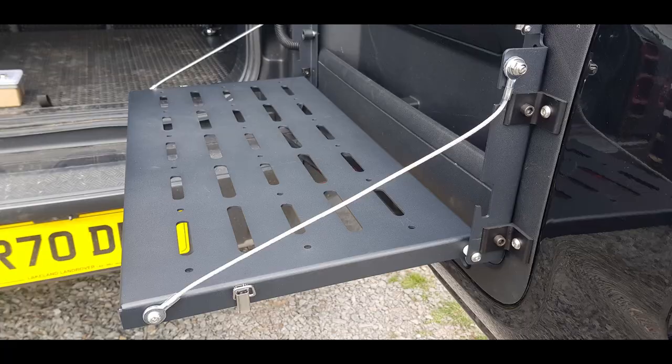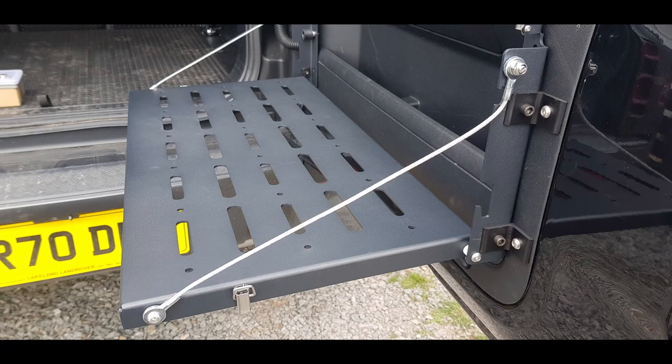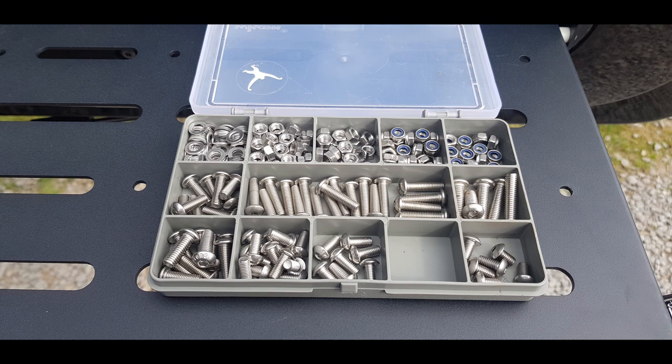Go ahead and fasten those L brackets to the table. You'll then bring that to the car, and when you try to use the original Land Rover Torx bolts you'll find they're too short. So you need to go and get some longer bolts. I had a kit from another job I was doing on the old Land Rover — I'll put a link in the description. From that kit I used some of the bolts, some locking nuts, and some washers.